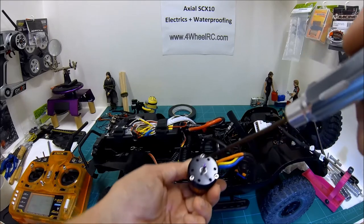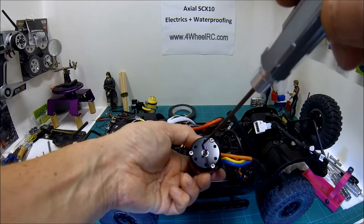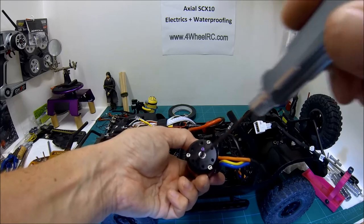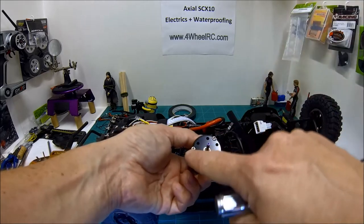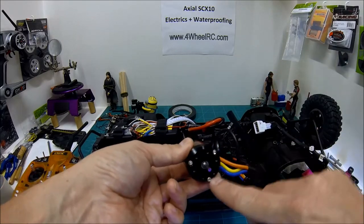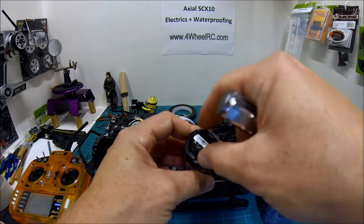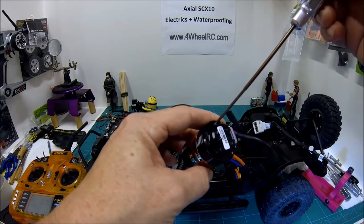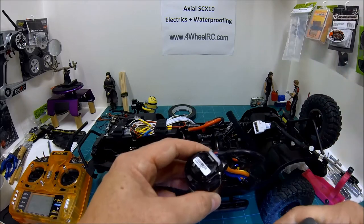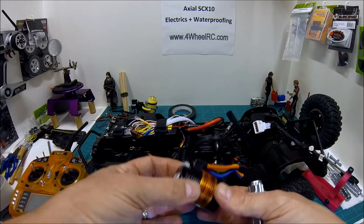These holes here, this colour in the depth of the hole, that's just a kind of cardboard washer to stop short circuits. Nothing to do with waterproofing, so water can get in all of those holes, also through the three silver bolt holes that clamp the whole case together. None of that's waterproof there. On the other end, this central part here, you can actually rotate to adjust the timing, and where that joins in there, there's no water seal provision at all. So in summary, this can is like a colander basically, so it needs a lot of work.